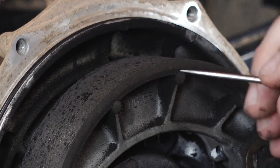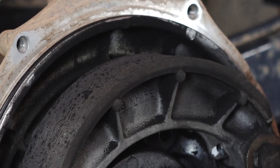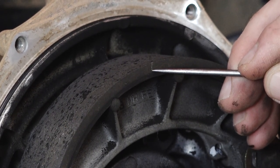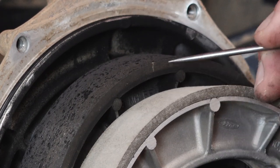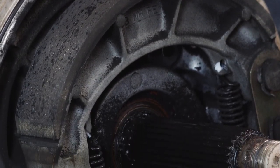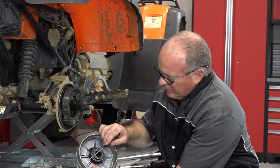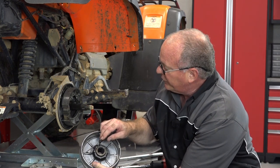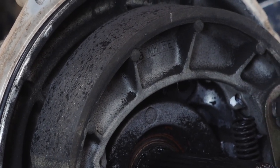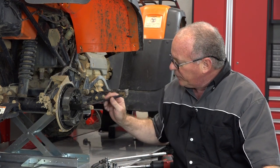Now we're looking at the brake shoes themselves. If you activate the brakes on your machine and nothing's going on, chances are they're not going to look like this — these are really in really good shape. See all the surface area it's got here? These are practically brand new compared to the new set. But if yours are worn out, it will be all the way down to the aluminum substrate right here. Another thing you want to check is the actual hub — it'll rust and you get an edge built up, then you start to see pitting throughout the surface area. The only thing I can see wrong with these pads is just a little bit of glazing, not that big of a deal, but I'm here to show you how to put on a new set, so that's what I'm going to do.